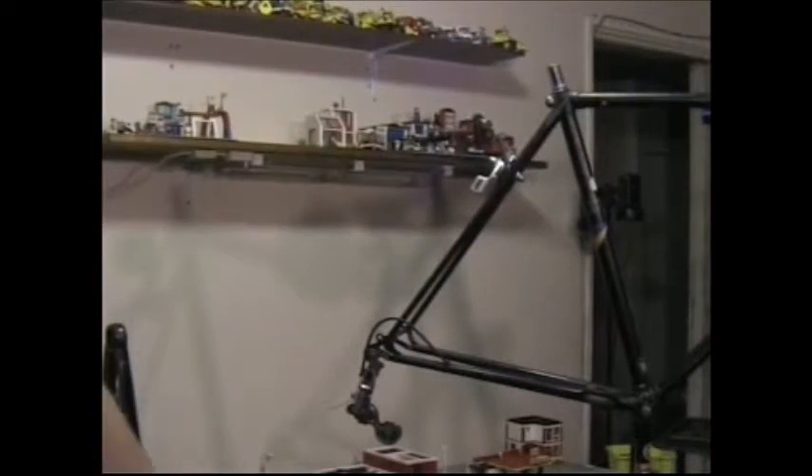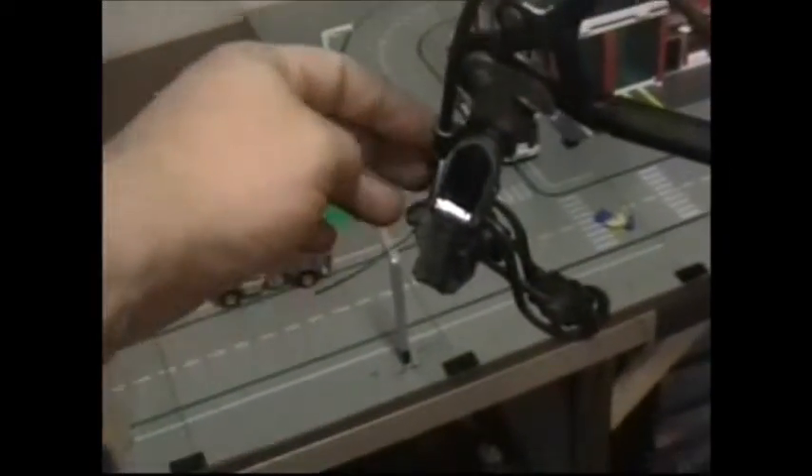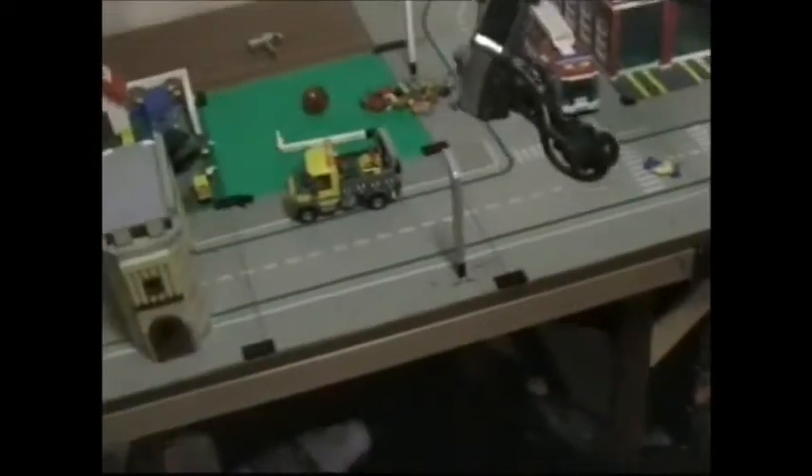This is the sort of bike I'd use a stainless steel cable on because so much of it is open to the elements. On a mountain bike more of this cable is covered by an outer cable, but with this one most of it is exposed. It's only this little piece between the frame and the derailleur mechanism itself that's covered.